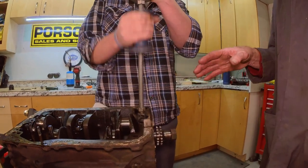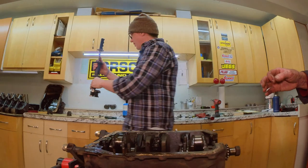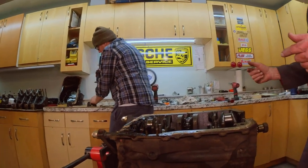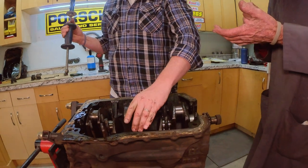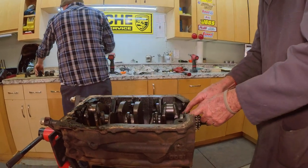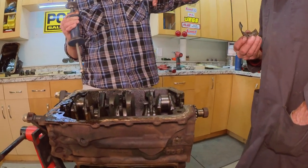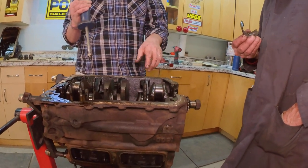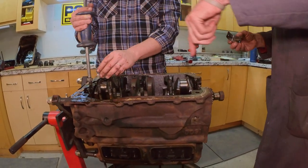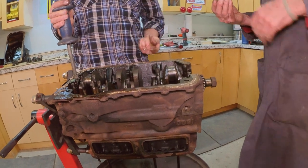Doesn't this remind you of Chrysler products, where they had the main bolts going down through, but they also had them coming in through the outside of the wall? What do they call that? My Mazda engine is like that. Isn't that how the Porsche 944 is, because it has the girdle, with the main bolts down through and studs through the side? It's multiple: the two mains, then a series around the outside, and another series around the outside of that. An LS is like that too.